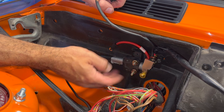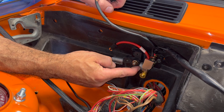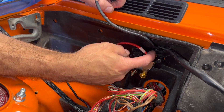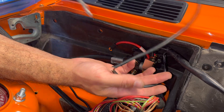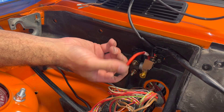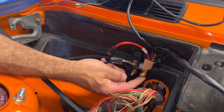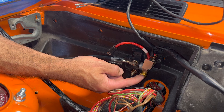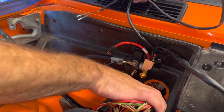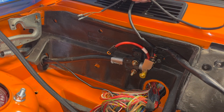I've completed my battery connections. I've got my battery connection here to the terminal - this goes to a break-off third-party terminal that screws onto and clamps onto the end of the battery cable and has a bunch of screw terminals at the top, of which I'm using a couple that go to the fuse box. This cable here is actually for the coolant level. I've broken that out - it's going to get connected through a terminal here. Down here is the big one that's reserved for the starter wire. We're not doing anything S54 right now - only focusing on chassis. Now we can actually get the battery turned on. Let's turn the key and see what happens.